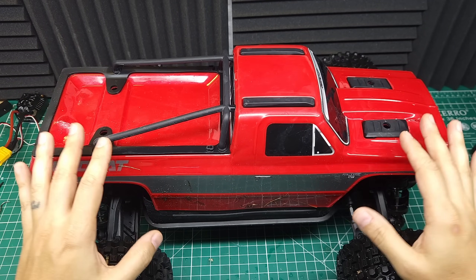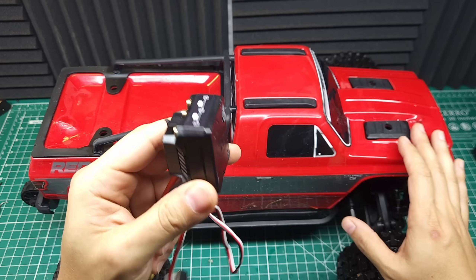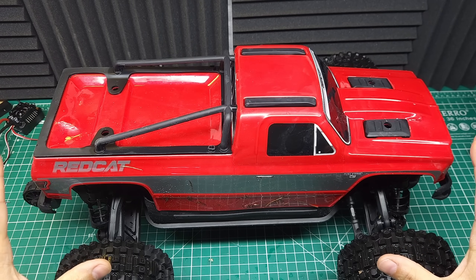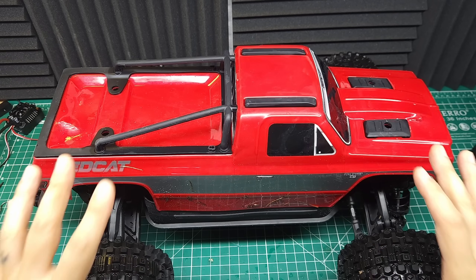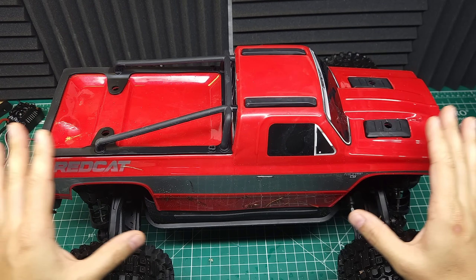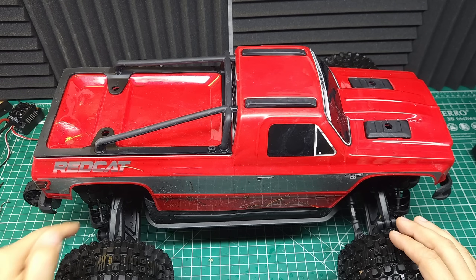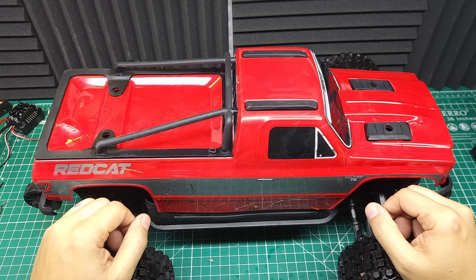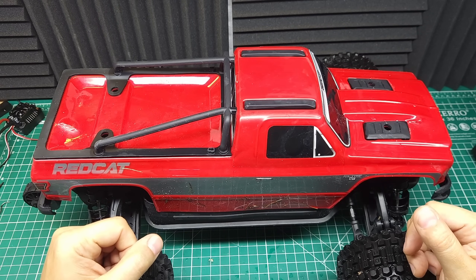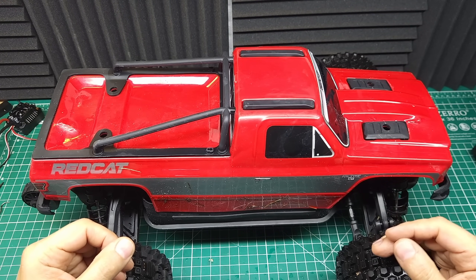It handles okay. It's a little bit narrow, so it does like to traction roll a little more than I'd like — we'll try to fix that in the next video. It has a decent amount of power, and I expect it would have a decent amount of power on the original ESC as well. This MAX 10 SCT is a known quantity and a good ESC. Overall though, at this time I'd have a hard time recommending this just because of those shocks. Maybe they won't be a problem in this platform, but they were a big problem in the WAV Racing vehicles, and given that it's almost certainly the same design, I suspect it's going to be a problem here too. These shocks are not the same length as the WAV Racing shocks, so you can't just swap them out. Until we figure out what shocks will work on this, there's a good chance if you land upside down and smack one of these corners, you're going to end up popping a rod off a shock, and then there's nothing you can do about it other than buy a new shock. It'll be interesting to see if Red Cat notices this and how they respond. They have been very good at coming up with solutions to these kinds of problems before — the Machete had a design flaw and they went out and fixed it right away. We'll just have to see what happens. If I hear anything from them, I'll definitely let you know. Make sure you stay tuned for that. Thanks so much for watching.